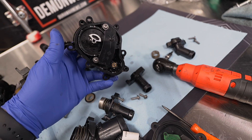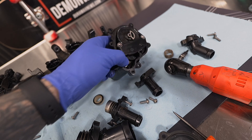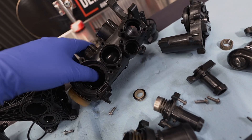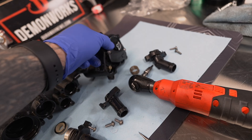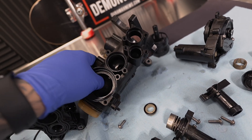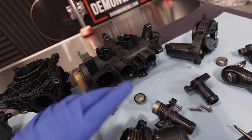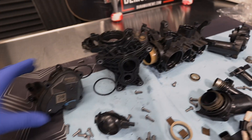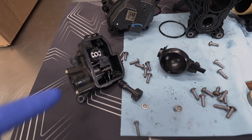The other motors do have some grease inside, but this whole setup is a very robust setup. I don't see anywhere on these that would cause binding or sticking. These motors are pretty solid and strong, so they're going to overcome any bit of binding inside. I don't think the binding issue is within the valve, I don't think it's these other motors — I think it's right here, this one with the worm gear. Let's get into the brand new one.